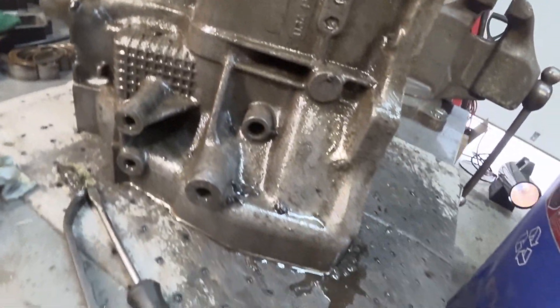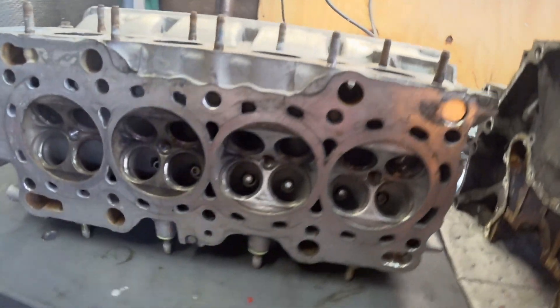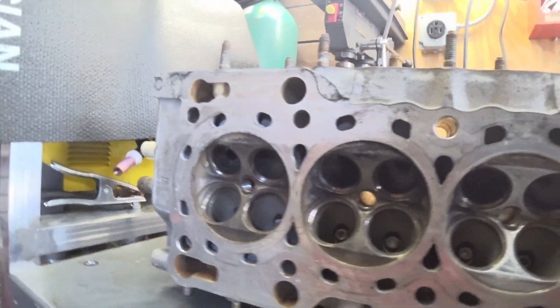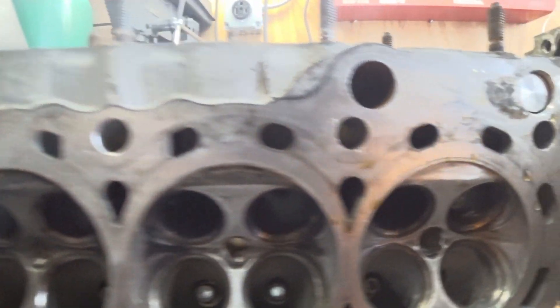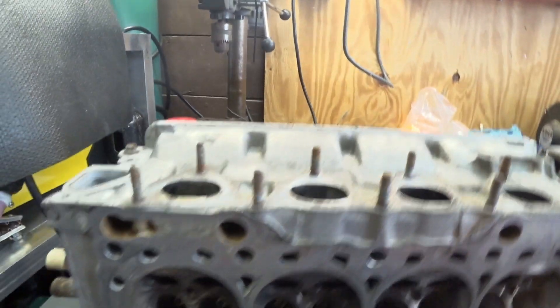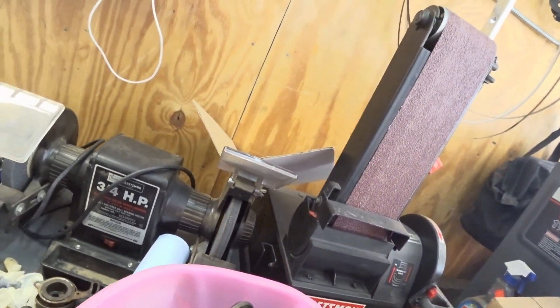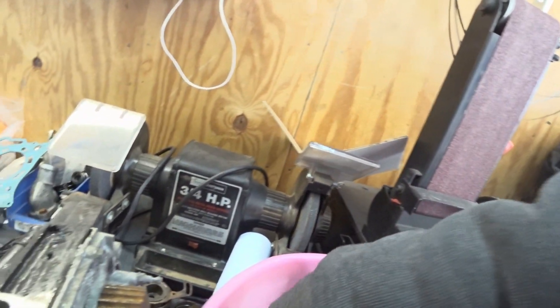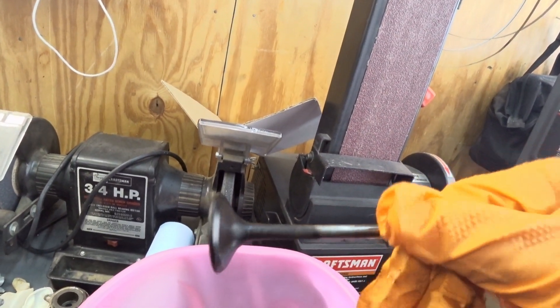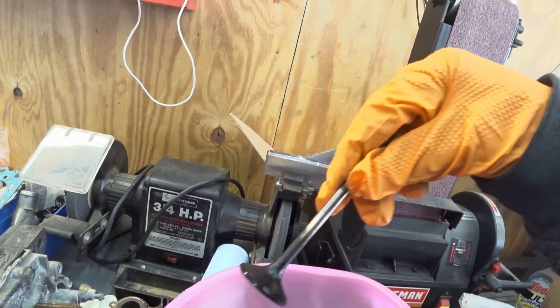Update on the engine block — took it out the next day, a lot of dirt and buildup is coming off. I'm gonna have to power wash the unit. This is the head — got it back after cleaning it last night, it looks a lot better than before. The intakes look like someone was trying to port it, they're okay. The exhaust looks really dirty, so I'm about to figure out how to clean those out. The intake valves are all pretty clean; the exhaust valves need work. I'm going to soak these in carb cleaner to take off most of the soot, then reassemble.